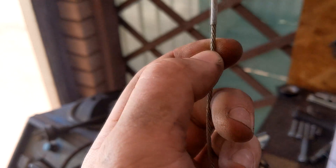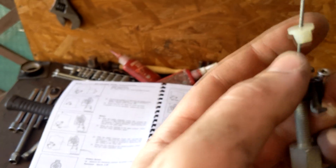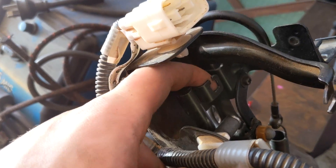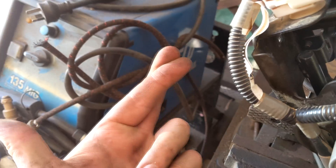I'll hook it up here, and I'm going to have to cut the cable down a little bit, and then I'm going to go to a bicycle shop and get a grub-screwed end - you can get little ends that go on these and just grub-screw down. Once I've got that end, I'm just going to chop this little plastic piece, cut a slit down it and slip it over that cable, and that'll clip into here - the grub-screw end. It's going to be a bit of a pain to put on. I'll probably have to put it on with the pedal out of the car and then fit the whole assembly in, but fingers crossed I can get it working.